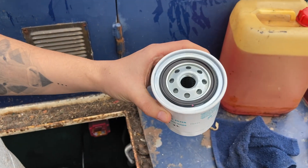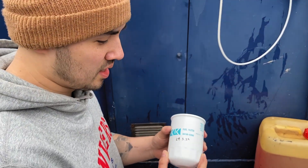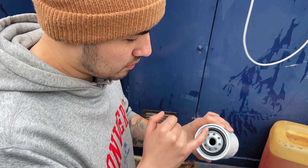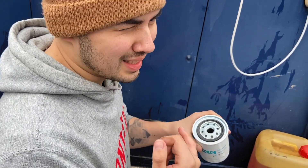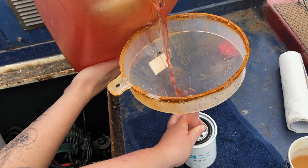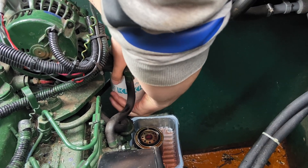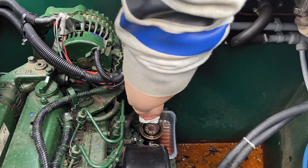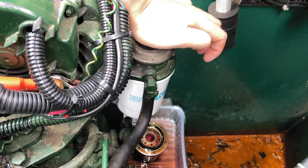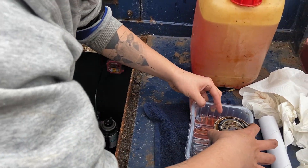We're going to take our new fuel filter. If you let air get into the system, the engine will apparently choke and then you have to bleed the air out of it. If you fill it with diesel first you don't have that problem, or at least you can get away with not having to do that. You should also put a little bit of diesel around the seal. Fill the filter up with diesel, wipe a little bit around the rubber gasket and then screw it back on. We found that tightening it quite firmly with our hands was just enough to stop it from dripping. If you need to draw more fuel through, you can use the pump on the top to help pump the fuel through the system. Finally, carefully remove the old diesel filter and dispose of it responsibly at your local tip.